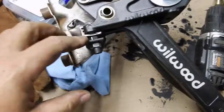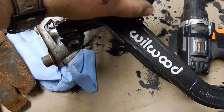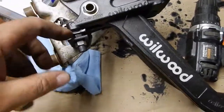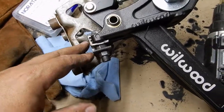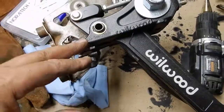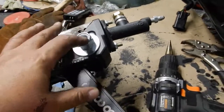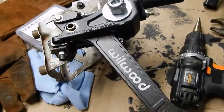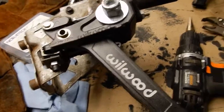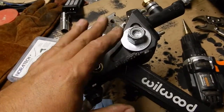And remember, this is really adjustment. Once I tighten this nut down and it squeezes the main part of this frame against this steel part, this is really doing light duty. It's not doing anything more than just kind of positioning. The vast majority of the tension will be taken by that jam nut there. Anyways, that's where I'm at. So once I've welded this in place, I'll have my clutch master cylinder mounted.